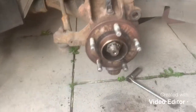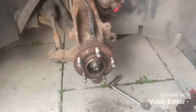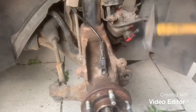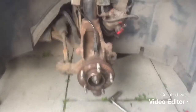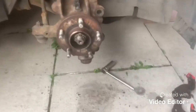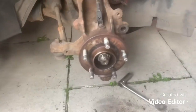The disc can be quite tight and stiff because it gets a bit of rust around the bolts. If it's really tight, I did a BMW the other week and had to hammer it off with a lump hammer. If they're really stuck it's just rust — get a hammer and lightly tap it around the back. If you're not replacing the disc, use a rubber mallet so you don't damage the surface. Just evenly tap it around until it comes loose — nothing else is holding it on.